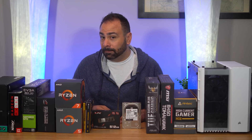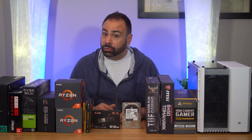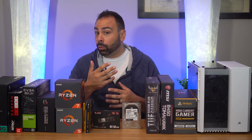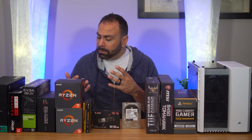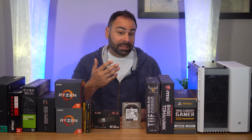Additionally, if you're serious about editing, you'll want what's called a scratch disk. This is either a separate partition on one of your drives or an entirely different drive altogether. This is the place where Premiere will store captured video, audio, or preview files that it needs while you're scrubbing through an edit. If you're familiar with bartending, it's basically a speed rail for your editing software. We won't be installing one today, but in my main system I use a second, smaller M.2 drive, and it results in a noticeable boost in smoothness.